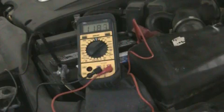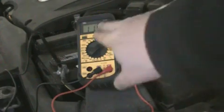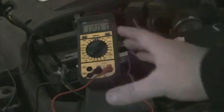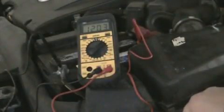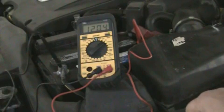There, you saw that probably went down to, what, 3 volts or so? Should not go down that low. I think about 10 is what you should see. Now it's slowly going back up. Now the thing with this is, the battery is taking a charge, but the cold cranking amps are what doesn't have enough of that to go around. So chances are there's probably a bad cell.